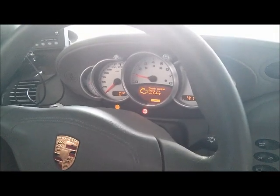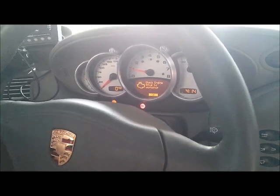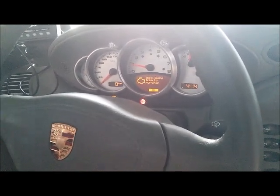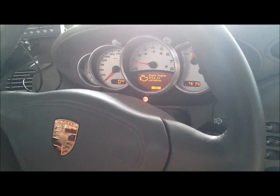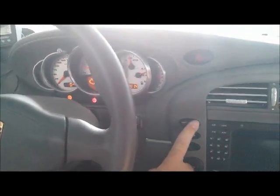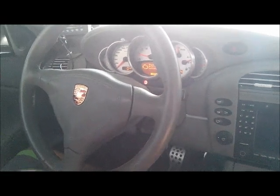So we just got back from doing the rolling anti-lag test, and as you can see, we have a check engine light — I'll let Jason explain why. So we're controlling all of this as well. I have mine set up to trigger a light anytime there's any kind of fuel pressure variance. When we did it, I get one pump turning on as the other one's staging, so we get just enough of a variance to trigger that light — that one's kind of cool. We can control that as well. The stability management also continues to work — you can turn that on or off. We're controlling the radiator fan, all three stages: low, medium, and high, and that's all calibratable as well.